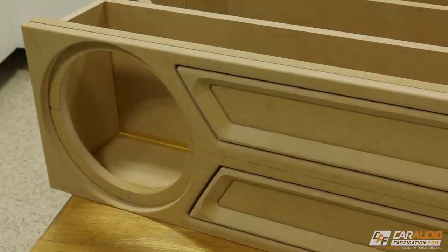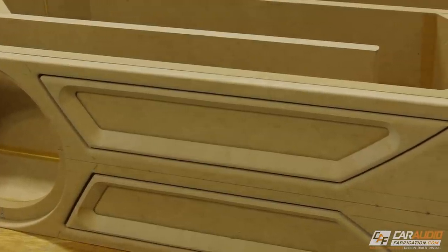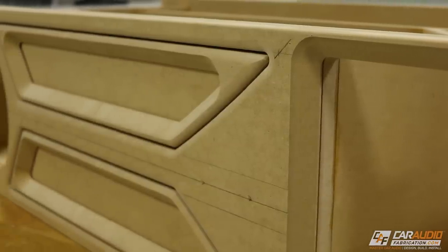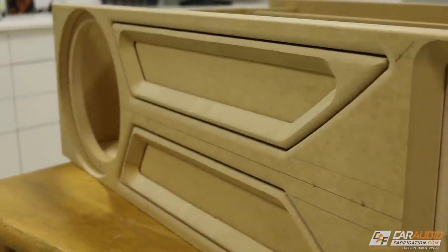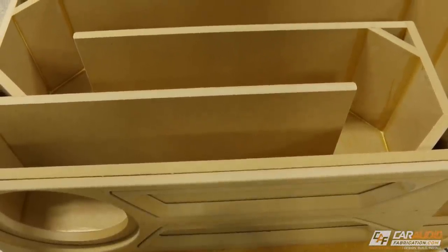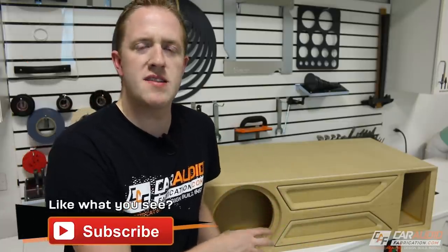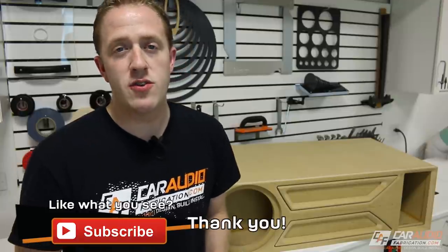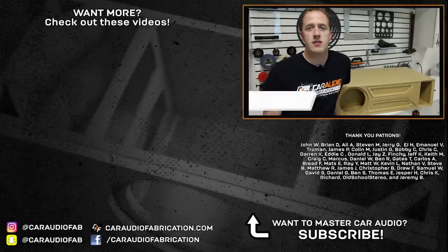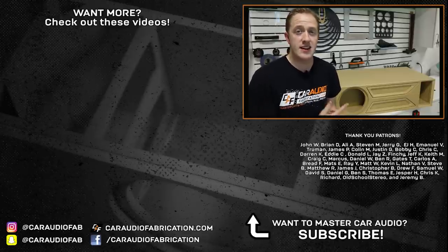I'm planning to wrap the outer piece of the baffle and some accent pieces with vinyl, while the rest of the enclosure will be wrapped in carpet, so I'm not permanently adhering those pieces yet. I'll probably use strong neodymium magnets to hold everything in place, and the inserts will be press fit. The top of the enclosure isn't mounted quite yet, but it's just a matter of applying glue and securing it with screws. We'll also want to play some music through it and give it a test — make sure you subscribe so you don't miss those future videos. A special thanks to the Patreon support team for helping crowdfund the making of these videos. Thank you everyone for watching.